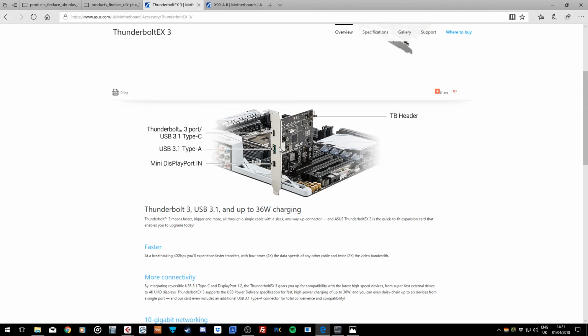So it's definitely something to look out for if you're on Windows, just to really be aware that the different chipsets for USB 3 at least are probably going to give you fairly different performance. And then maybe if you have a motherboard that only has, say, ASMedia, or I guess even for me, some Intel based chipsets, that you might encounter some problems there. I think you can get around it by buying a PCI Express based add-in card that has different USB 3 ports on, but just something to be aware of, because obviously everyone expects to buy it and it work straight away.